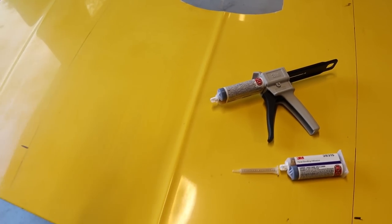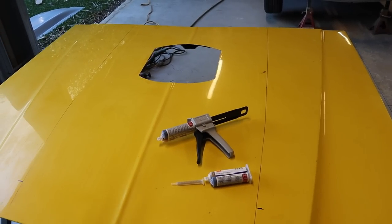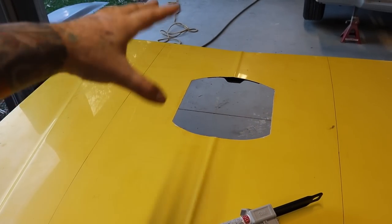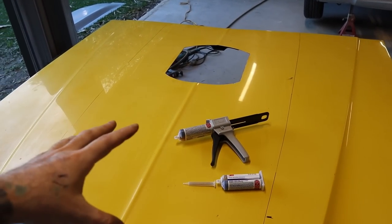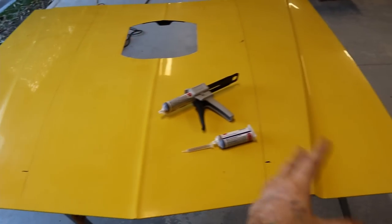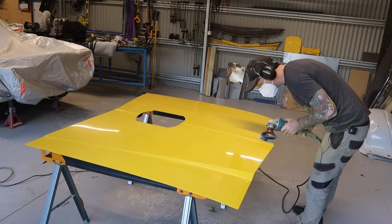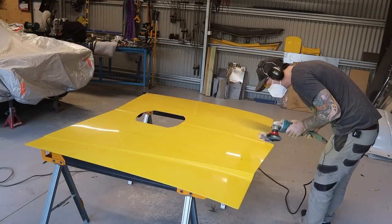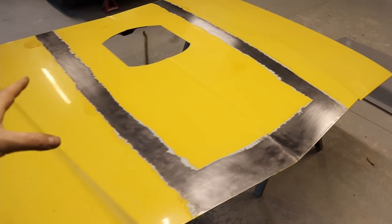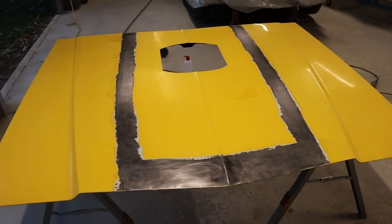The paint's pretty good. What I'll do is scuff it up and get it ready. Then when it comes time to paint the bonnet, I can just blow some color in or some epoxy in here, and it's already sanded back. The ends, I'll probably just use a bit of paint stripper to take them back. So that is taken back to bare metal. Now I can fit the scoop on, get it all marked up dead center, take some measurements, and then I can start gluing it in.